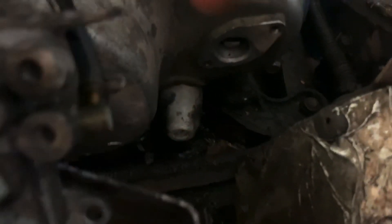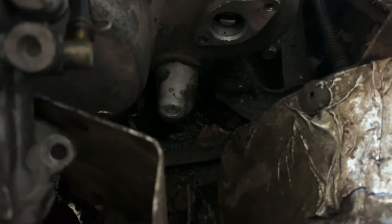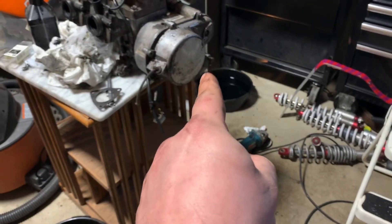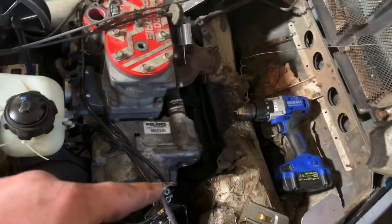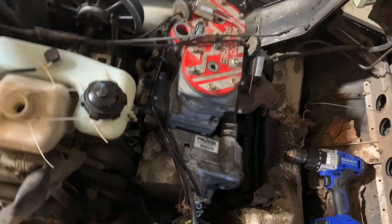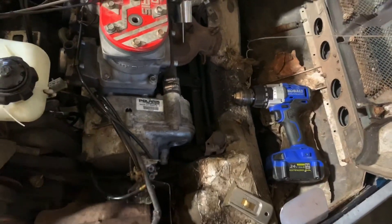As I was priming some more I looked down — this is a cooling jacket, and on an XC it's got a nipple because it has another coolant hose going to it, whereas these '97s do not. So I stole the nipple from the XC to put on the '97 motor. The '97 motor was in the '98 chassis, and now I'm putting a '98 motor in a '97 chassis — this is getting confusing. Anyway, I need to put a plug in there.